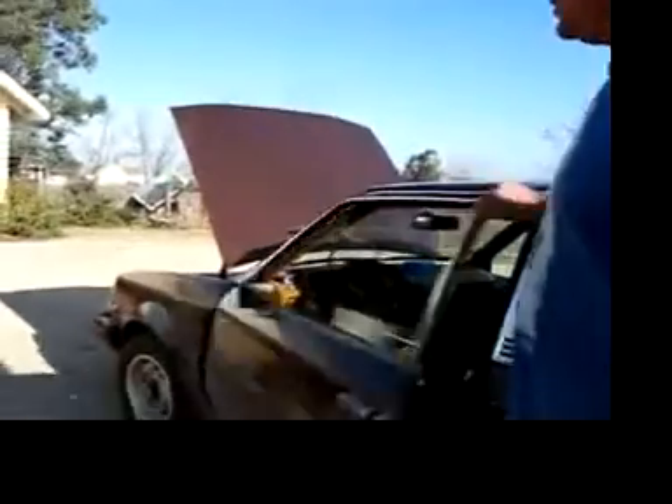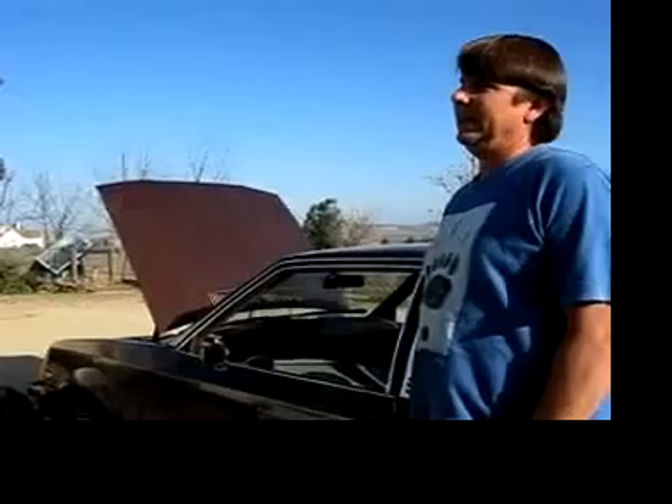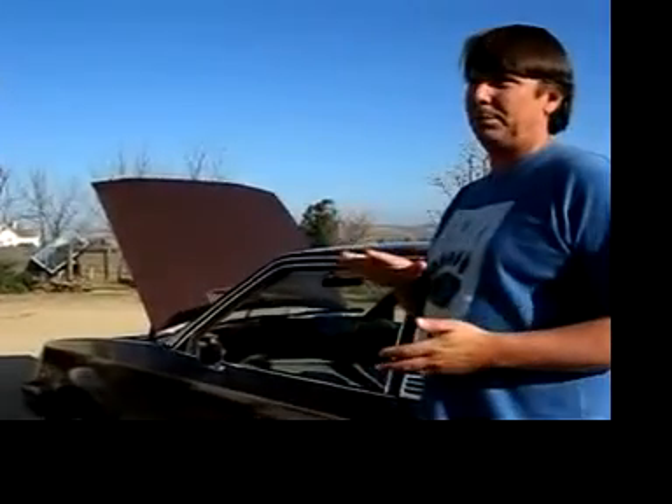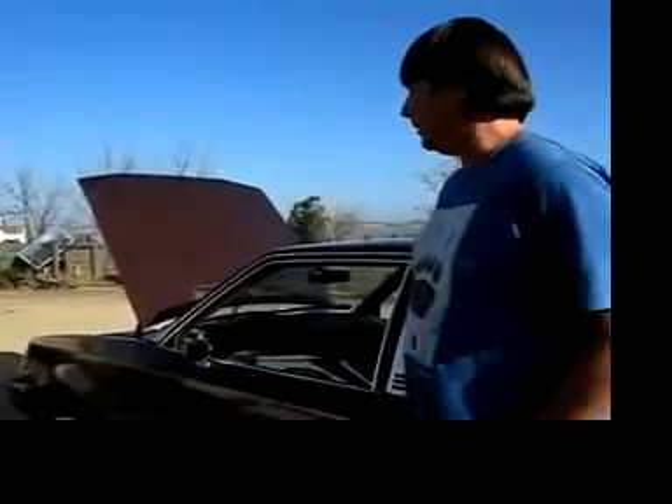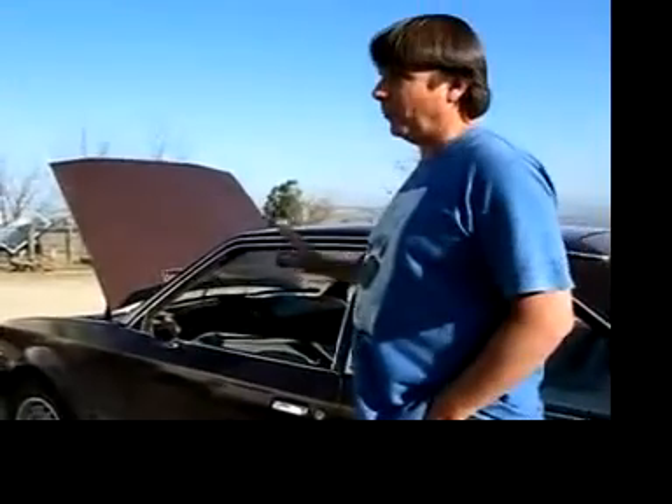When it's full, they advertise 50 miles range, but I would be too scared to rely on 50. Also, if you get below about 20-30% of charge, you're damaging your battery, so you really don't want to ever get that low. A more accurate range is probably about 40 miles.